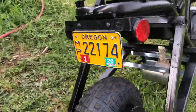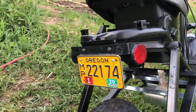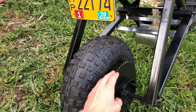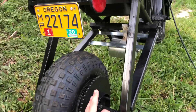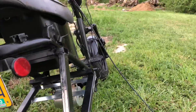This is the old license plate from the original moped — it's not mine so I don't mind showing the number. Yes, I do live in Oregon. I've got a 41/420 type sprocket on here with a drum brake, and I'm hoping to put a drum brake system on here using the original rear brake cable, which is mechanical, so I have a rear brake — because right now I only have a front brake.